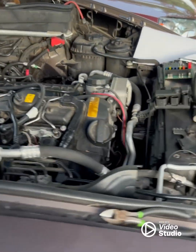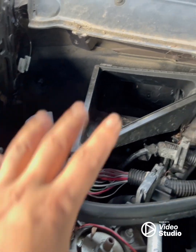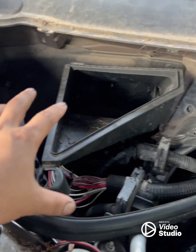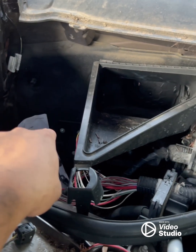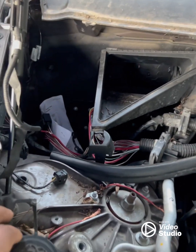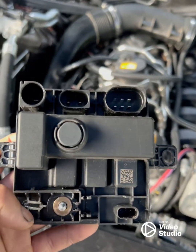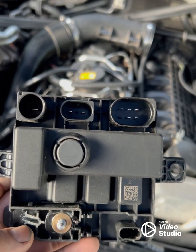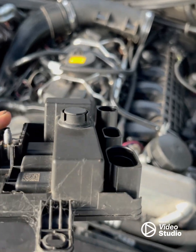What I finally found is a supply module on the right side of the engine compartment, under the cabin air filter. If you remove the cabin air filter housing using a 16mm ball socket, you can access this module — it's a power supply to the DME, or engine control module.